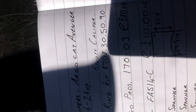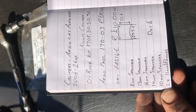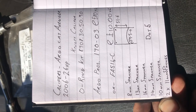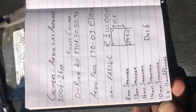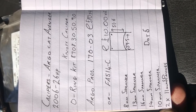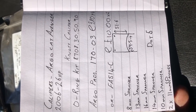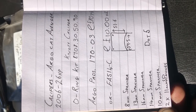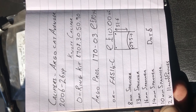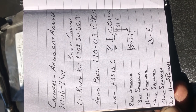I've put a link here for you on this piece of paper so you can see the things that you will need, and also an alternative brake pad which is a lot cheaper — it's used for go-karts and it's FA514C. I've measured it to be the exact same size as the Argo one at a fraction of the cost. I hope this is of help to you and makes your life a wee bit easier, because it's not a very pleasant job. All the best!